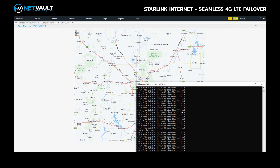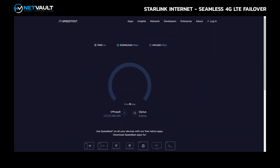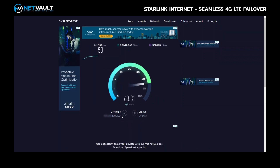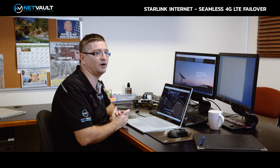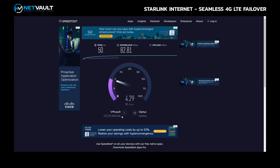The ping tests continue. If I run another speed test on this connection now, you'll notice the public IP address doesn't change — it's still one of our IP addresses, not a Starlink IP address. While the speeds are a lot slower — 80 to 85 megabits per second download — it has failed over in under one second and is still very usable for a home office or any environment needing continuity of service. Uploads are around four to five megabits per second via 4G LTE, but we failed over in under one second.